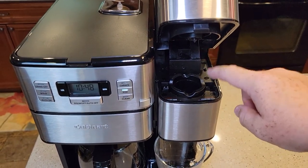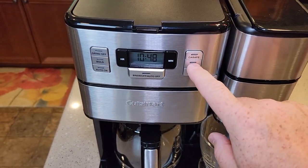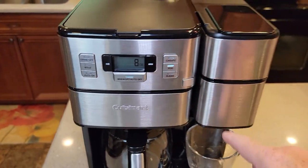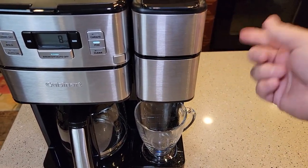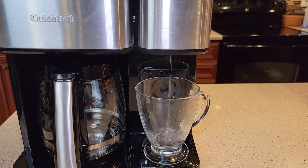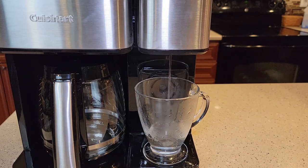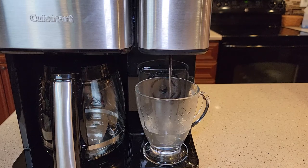When you think you've got it clean, make sure the bottom needle basket is in. Don't put a K-cup in — just close it, come over here, do a pod, do an eight ounce. These are called fresh water rinses. You should be doing these anyway about once a week — it helps keep things clean. But you still do have to take it apart and clean it once in a while. I do a fresh water rinse at least once every two or three times a week. There's how your stream should come out — nice and even. That means those four pie shapes are nice and clean. You'll be surprised at the coffee grounds you'll see in here and the water is kind of discolored, so it's really a good idea to do these rinses.